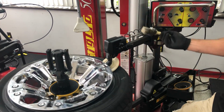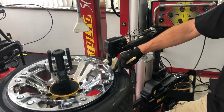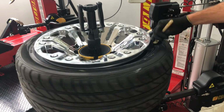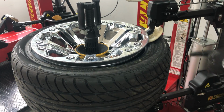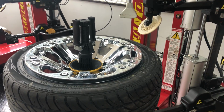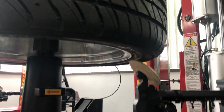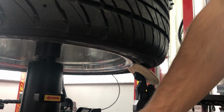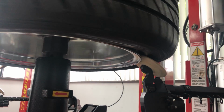Remember, if you have a difficult wheel or any tire, you should lube it while you're changing. We like to lube every wheel and tire, even when it's an old one that needs to be replaced. It'll be easier on you, it'll be easier on the machine. When you go up, the disc will release. We're going to do the same on the bottom. So basically, I will go up until I'm in contact with the tire. After that, I know I can open the disc between wheel and tire, start rotating, and even here, start going up little by little.